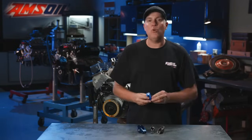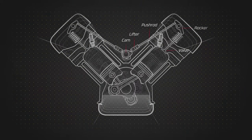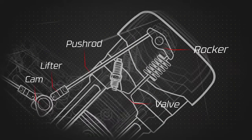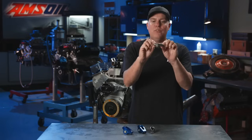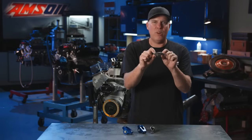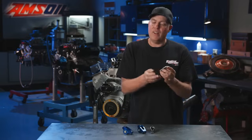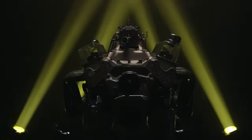This is also the episode that you overhead cam guys are going to hate because your engines don't have these, so maybe I should explain what they do. The rocker arm is basically a little implement of leverage that opens and closes the valve. Starting with the camshaft rotating, that translates lift through the tappet, through the pushrod into the rocker arm, which multiplies that lift usually by a ratio of about 1.6 to 1.7 to 1, and opens and closes the valve. There are a lot of aspects of the rocker arm that can affect performance, and that's what we're going to find out today.